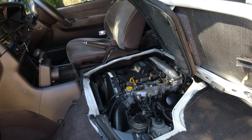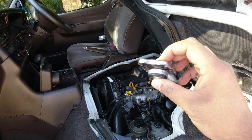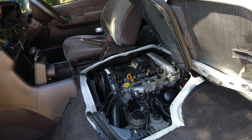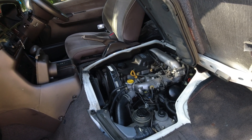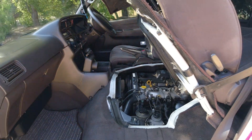So if you are losing coolant but don't have any visible leaks, it might pay to have your radiator cap tested, or just replace it with a brand new one and see. It's not always something as catastrophic as a head gasket. Alright, thanks for your time — take care, bye.